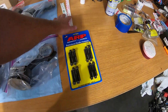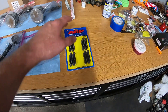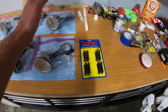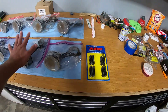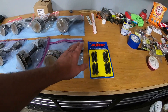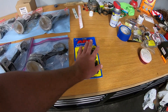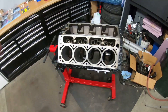I know there's probably some debate — oh, you don't need that, or maybe you do. It was just kind of an easy thing to do to make sure the bolts aren't the failure point. This isn't really going to help with being able to add more horsepower on a Gen 3 rotating assembly, but this is more of an RPM thing where you can turn some higher RPMs with a little bit more safety factor.